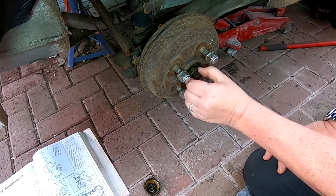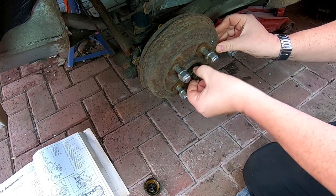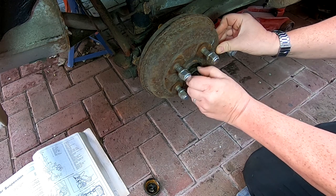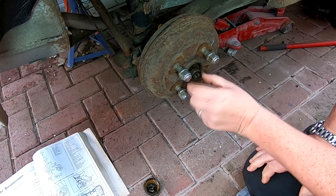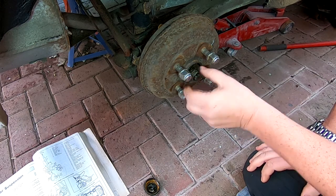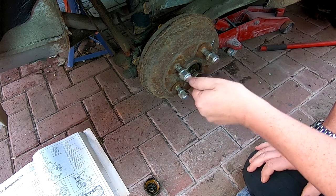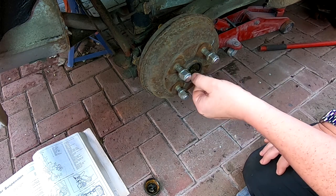It's not tight, it's loose. So that is apparently how you adjust the bearings — you normally nip this up to a certain torque until you take the play out of the bearings. I was expecting that to be a bit tighter than that. It's probably a tapered bearing in here. So let's just wind this off. There's not too much rubbish under here, but as you know, a lot in there was all covered in oil.